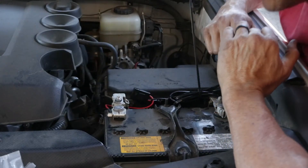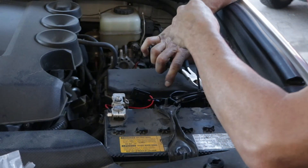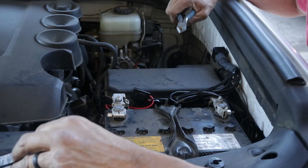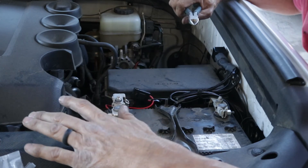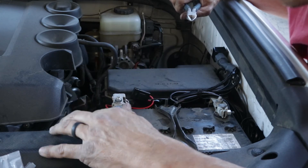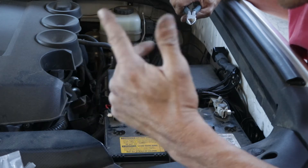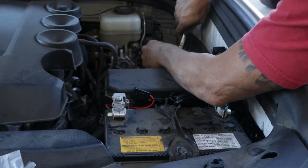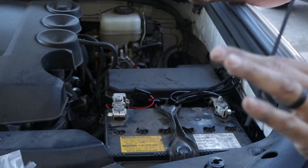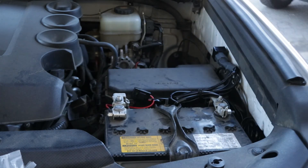Now this is just a temporary solution, or you can make it permanent because everything's out of the way. This does look pretty nice. If this is going to be the only light that you have, that'd be great. But if you're going to have a bank of lights, then I would definitely invest in a switch controller where you have those relays that are built in as well as fuses. Everything is buttoned away, everything looks good. I just connected the switch — let's test out the light.